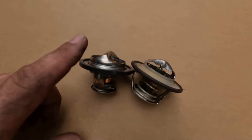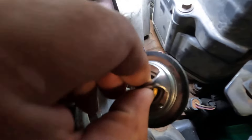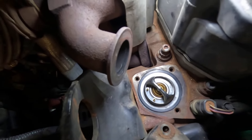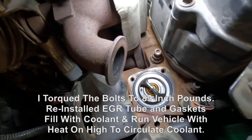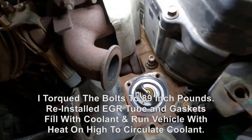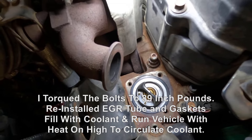Let's get ready to put this back in. Clean my surface right there and make sure everything is clean on the housing and also down in here. That new thermostat is going to have the O-ring around it — that's what's going to seal it — so just drop it in place right there. Then I'll be ready to install my housing, put the bolts back in and torque it down. I'm not really sure what the torque specs are — on the 6.7, the 5.9 engine shows 89 inch-pounds of torque. So I'm just going to snug them down, but you really don't have to tighten them down too much.